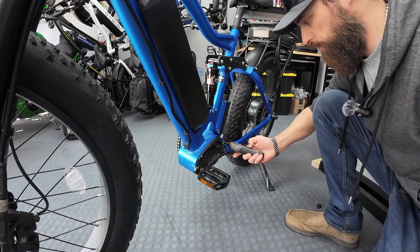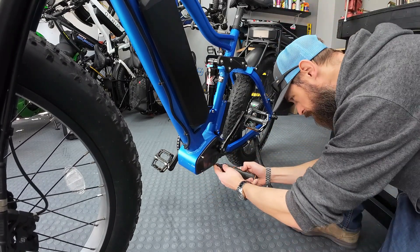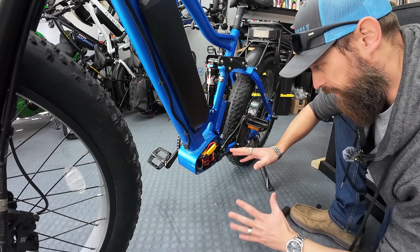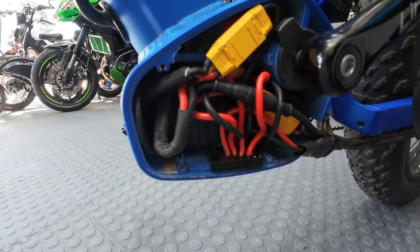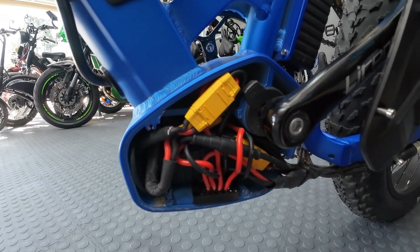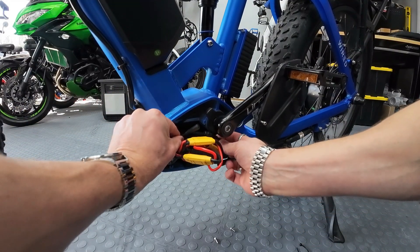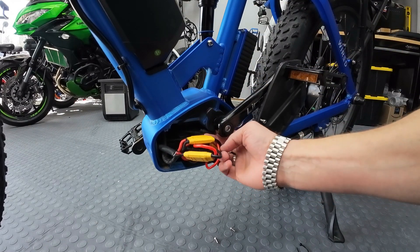First I need to get in here to access the controller plug. Now we need to find the plug that goes from the rear controller into the front controller - it's a really big spaghetti mess of wires in here, packed pretty full. You've got the balancer on the bottom controller and all the XT90 connections in the front. I found the little plug I was looking for - it's this little black one right here. That's the wire going from the rear controller to the front controller and you need to unplug that - you don't want those connected to each other.